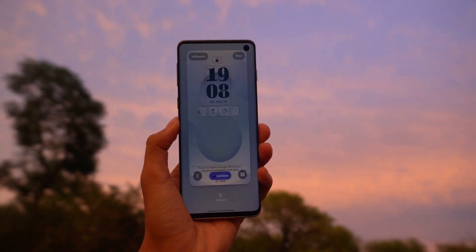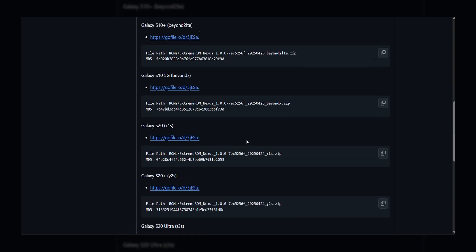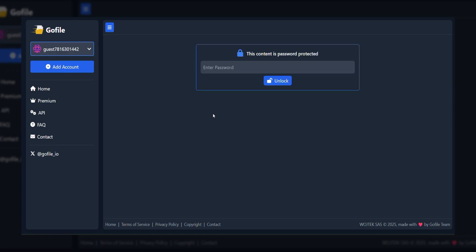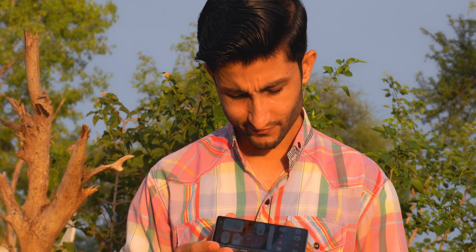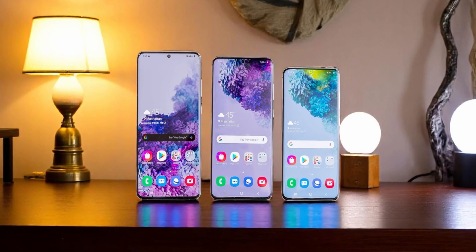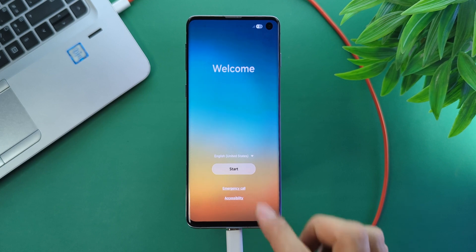If you're still in, cool — links to everything you need are down in the description. You'll land on a page where you can scroll through and see all the supported models listed. First thing: copy the password they give you. Then match your phone model with the identifier code next to it, and click on your phone model to get into the folder. Quick note: only the S10 series needs the repartition files — S20 and Note 20 series don't need that part. Make sure you download the right stuff for your exact phone and save it all to a folder on your computer to keep it clean and simple. I'm doing this on an S10, so I'll be showing that version of the install, though the process is mostly the same for all supported models.